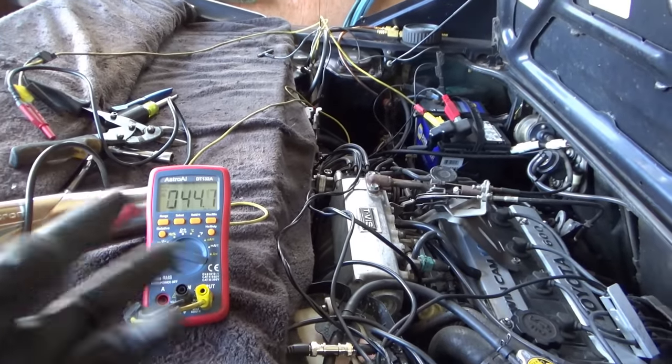Like I suspected, these ranges are not very helpful. So there's battery positive, then VCE2 - VC is after this little resistor, that's like the supply voltage to the sensor, 6 to 10 volts. VSE2 measuring plate fully closed, key ignition switch on: 0.5 to 2.5 volts - we're right at the maximum, 2.5 volts. Engine running, measuring plate fully open: 5 to 10 volts - at wide open throttle we're at 8.7. We're within all the parameters, but it doesn't mean this thing's working right. VSE2 idling: 2 to 8 volts - at idle we're at 7.2.